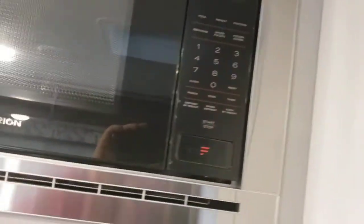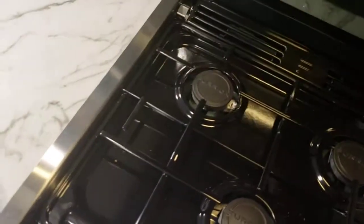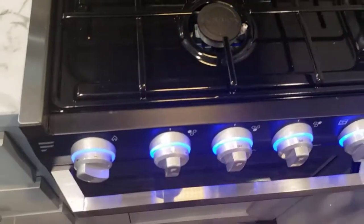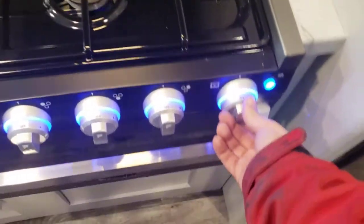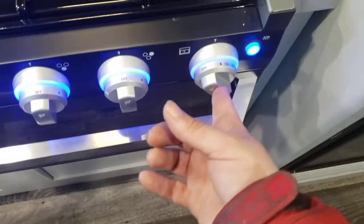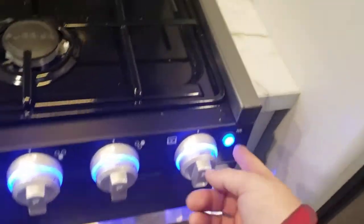Microwave — it's only going to work when you're plugged in. Stovetop — flip and fold to access your back splash. Turn it to the flame and it lights. Same for all of them. Your oven is a little different — push and hold the flame like that; that's your pilot. You look in there for the pilot light, and you crank this while pushing this in until your pilot's lit. There's also a light that turns on the lights around here as well as your oven light.